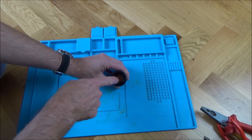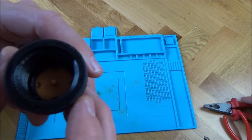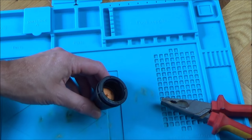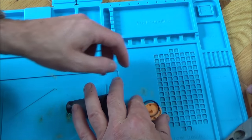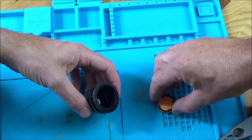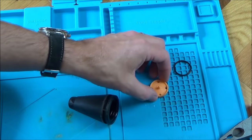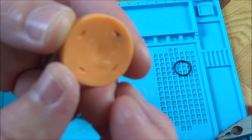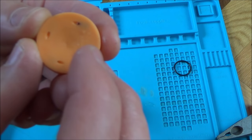My brother thinks we need long nose pliers to pull the middle section out - there's a kind of flesh-colored section. We give that a yank out. That came out with an o-ring. There is a bit of a mark there, and that one is definitely blocked - completely blocked. These are the little holes I was talking about and there's some gunk in this one, so we're going to get a needle and free that up.